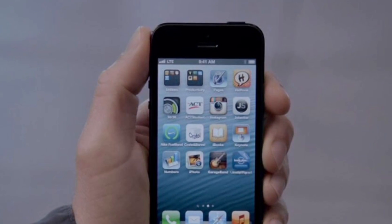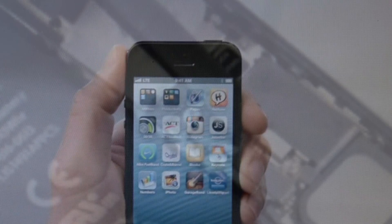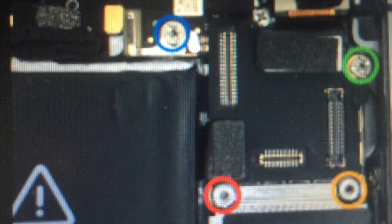After you remove the cover and remove these four screws, connect your battery again. Don't close your LCD yet — hold it open and press the power button. If the phone boots up within thirty seconds, you've fixed your blue screen. Then go back into the phone, loosen up the battery again, take the cover and put it in its place, and only put in the three screws — the blue one, the green one, and the red one. Don't put the yellow screw back, just leave that out. Connect your battery again, connect your fingerprint cable, and you've just fixed your blue screen of death.